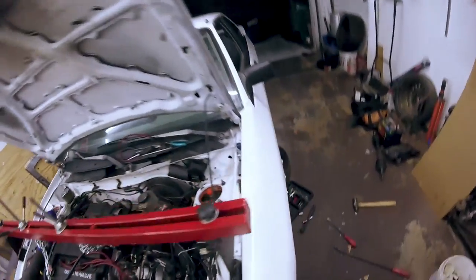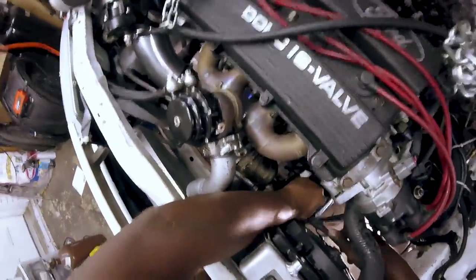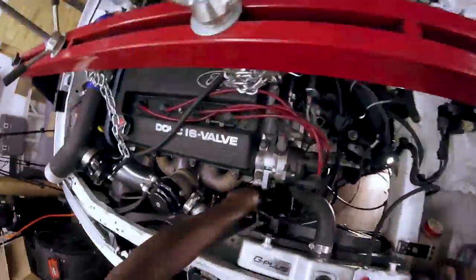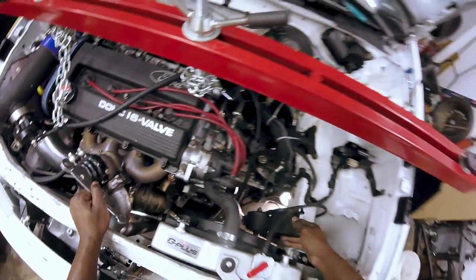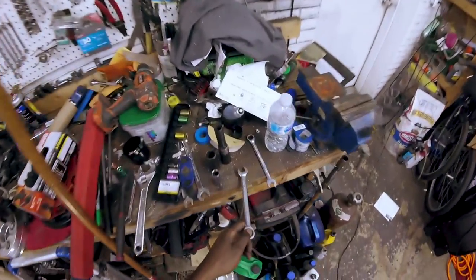Get the engine mount out - I think it's a 14. I can get the mount out of there. With that mount out of the way, I'll get to this bolt and the two 13s that hold the clutch slave on.